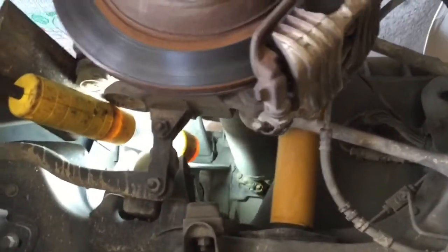If you read the forums you'll find there are probably as many different ways to get a u-joint out of a shaft as you can come up with. Some people say use a cutting torch and cut the center out, then drive out one bearing cap at a time. Others say use an arbor press. I don't have either with me right now, so I'm going to use an oversized socket on the bottom and an undersized socket on the top and give it several good whacks. The first one came apart really easily — about three good whacks and it was out.